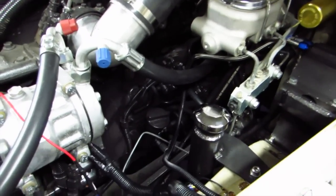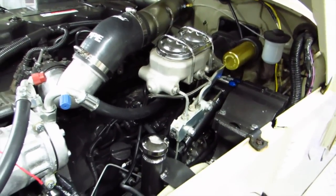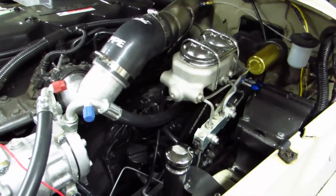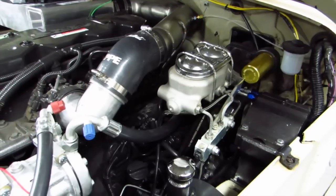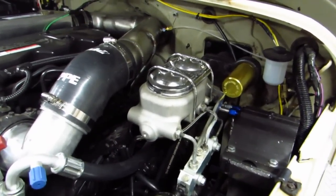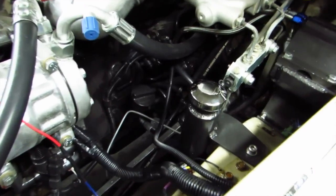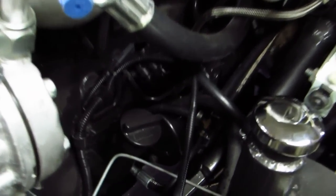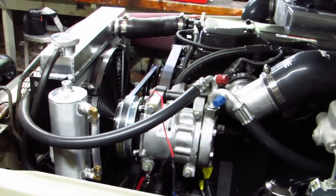There is a story behind the power steering pump that I'm not going to get into, but it's a lot of custom work to make it work with this 4.5 liter. They don't have a power steering pump that is a direct unit that'll bolt on, so we had to work with a few shops to get the right reverse rotation pump, and it just goes on forever. So anyway, long story short, here is a hydro boost brake unit. It is a disc master cylinder with a remote reservoir, which goes down into a Saginaw pump, which is mounted down there on the engine. A little aluminum reservoir for the radiator.